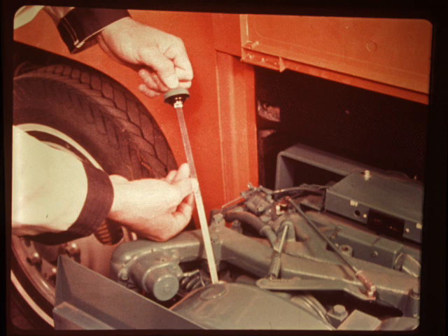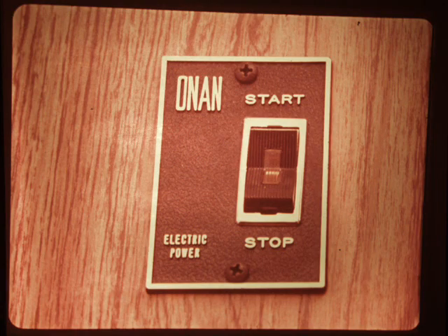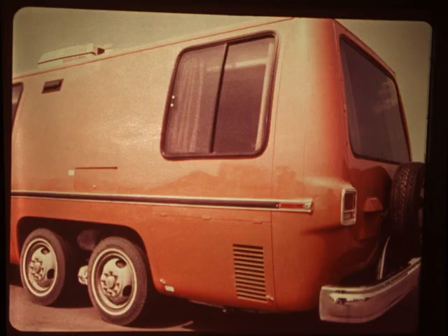The external power cord should be plugged into the motor generator receptacle before the motor generator is operated. Also, the motor generator should not be started unless the crankcase is filled with oil to the F mark on the dipstick. The remote switch to start the motor generator is inside the motorhome — above the refrigerator on the 23-foot model, and at eye level on the side of the refrigerator on the 26-foot model. A start-stop switch is also located on the motor generator itself. It is essential that whenever the motor generator is operating, the left rear window of the vehicle be kept closed to prevent the possible entry of motor generator exhaust gases into the vehicle.